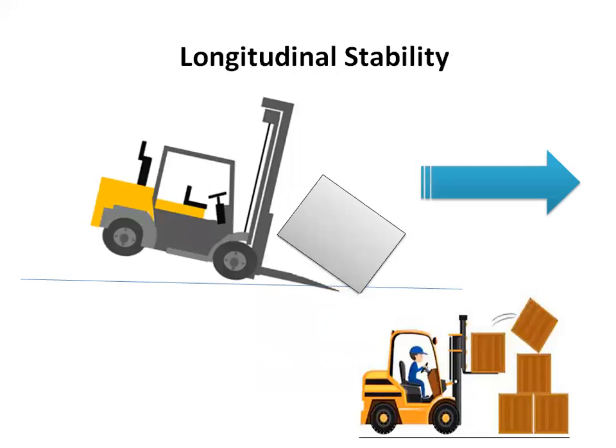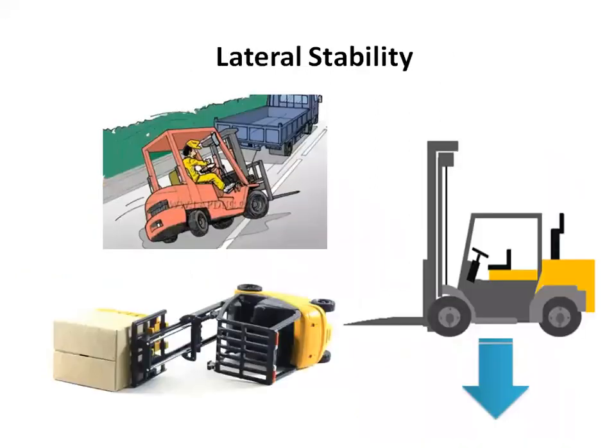Let me discuss the aspects of some of the truck's stability conditions. Lateral stability is a truck's resistance toward turning sideways. For example, if one is driving fast and turning in a 90-degree corner with an unloaded truck, there's a chance that the center of gravity will shift out laterally. When that happens, the truck might overturn to the side — that is, to the outside of the curve.